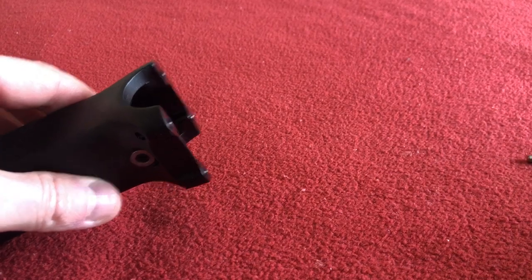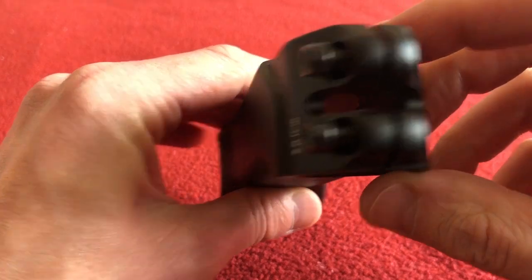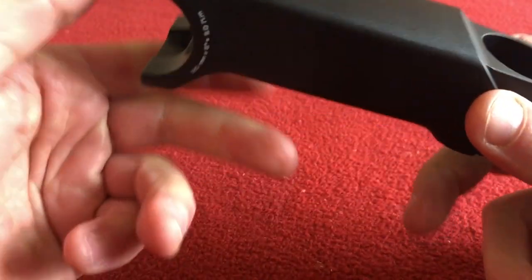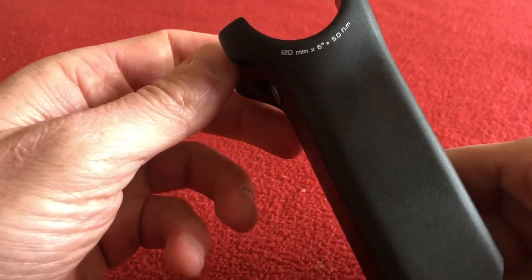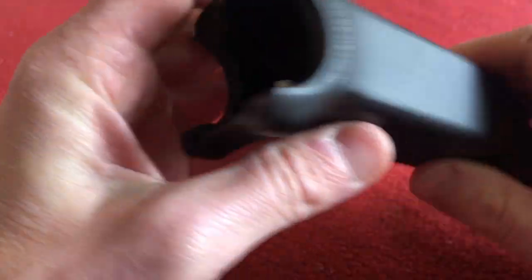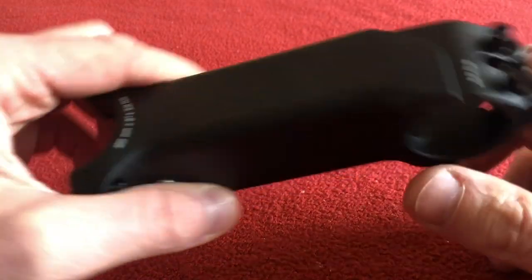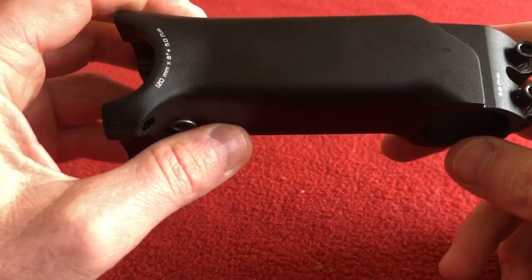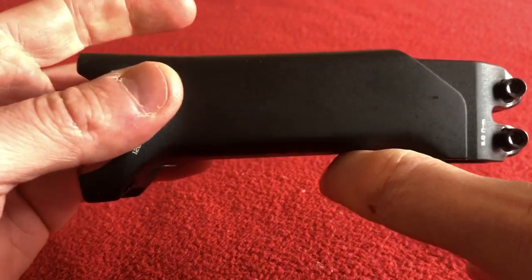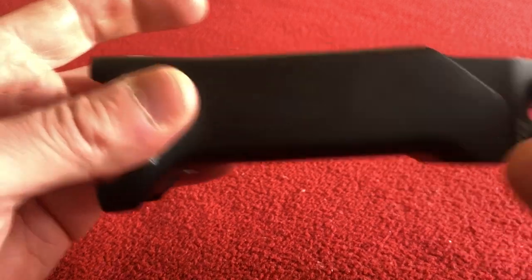Let's put that to one side. As you can see, it's hollow all the way through. Tighten to 5Nm. It's a 6 degree stem. I thought the cabling was going to go inside and come out somewhere, but it doesn't look like there's room there. So I'm thinking what it does is the Venge spacers sit out quite a bit and the cabling just goes underneath and drops down the front. I don't own a Venge — I'm just guessing.